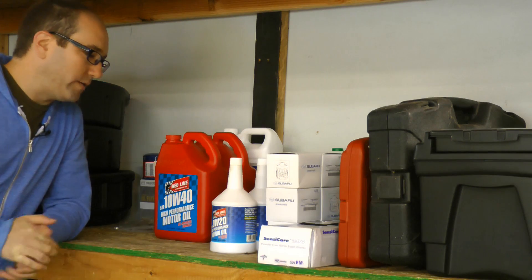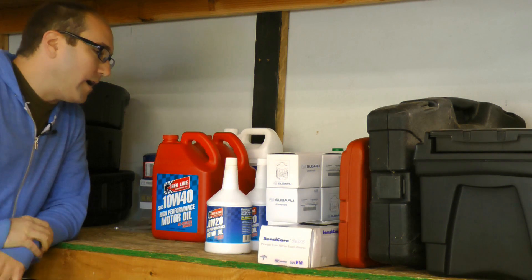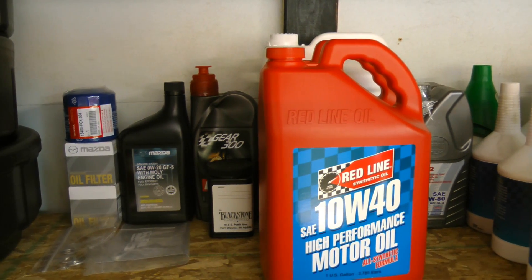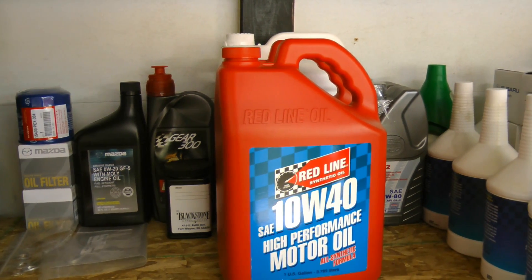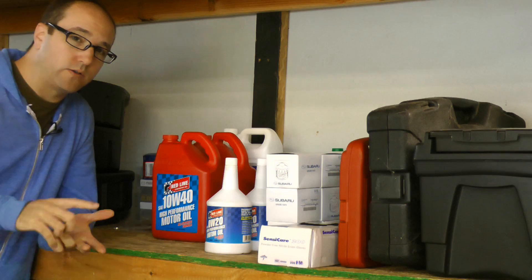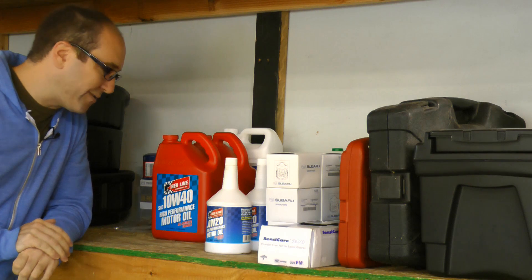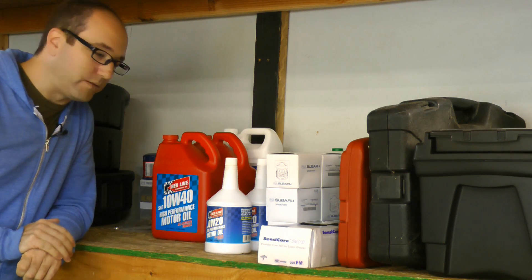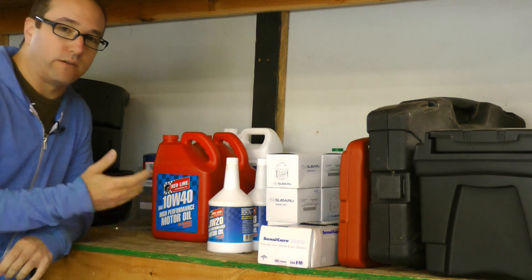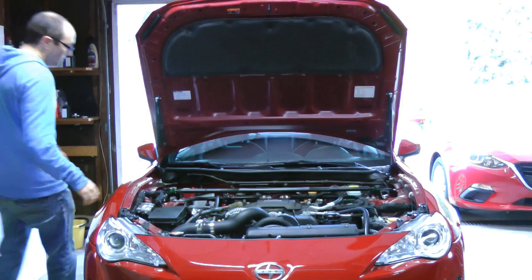Truth be told, this all boils down to different types of motor oils, and I've gone through several. Pick a brand — I don't really care which one — but make sure if you're going to be changing oil grades for street, track, and winter driving, that it's all the same brand. Generally their formulation and additive packages are the same or similar throughout. For example, Redline's 0w20 additive package is similar to their 10w30.